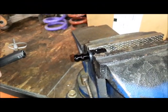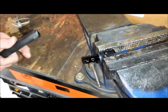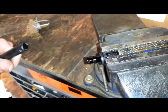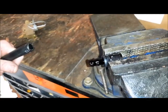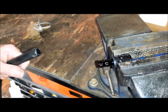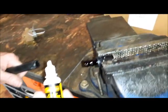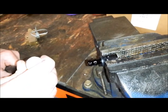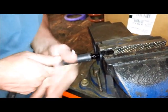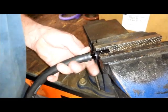The Russell Twistlock fittings are kind of cool because they allow you to use AN fittings for a high-quality plumbing job, but they're real easy to assemble. You'll notice that on the end of the fitting you've got a barb there, so that when the hose goes onto it, it goes on relatively easy but it's impossible to get off without cutting it. When you buy this from Russell, you can also get their lubricant, which Ron has already put on the fitting there, and it's just a matter of pushing the fitting on there. It's quite a struggle, but it's worth it because it's going to not come off.